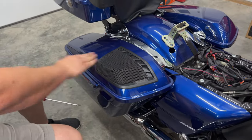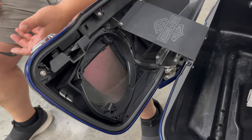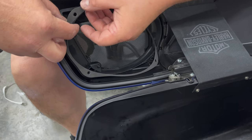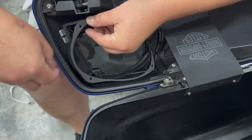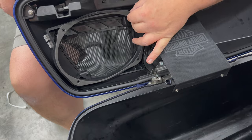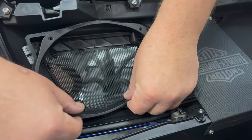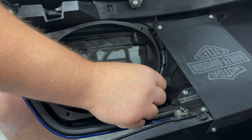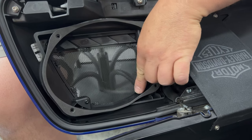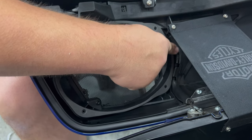Next step, we'll put a gasket on the backside and I'll show you real quick how to mount the speaker to it. Hertz is going to give you one of these gaskets — they've already made this fit perfectly with the SX690 Neo 6x9. You're going to send out this gasket and put it in the right place after you get it installed. We're just going to line up each one of our holes. Once you've got a couple of the holes lined up, before you really press it down, make sure that this part of the gasket is right over where the speaker is going to ride — do that one hole at a time. I've got to make sure it lines up and lays right on that area where the speaker is going to be pulled in, because we want this to be watertight and proper gasket placement is going to be crucial. Same thing on this side — move the gasket out and lay it on top of that ridge, then press it down to make sure we get a good solid stick.